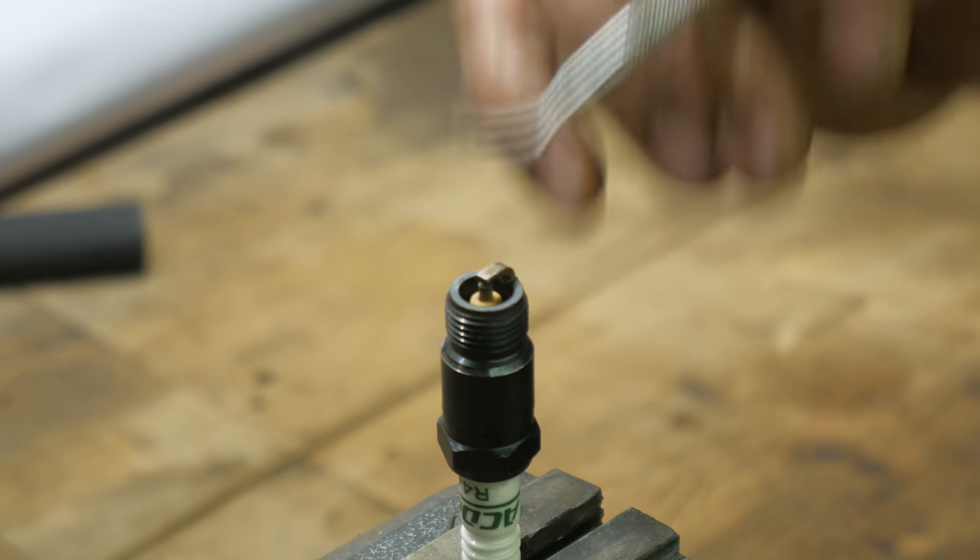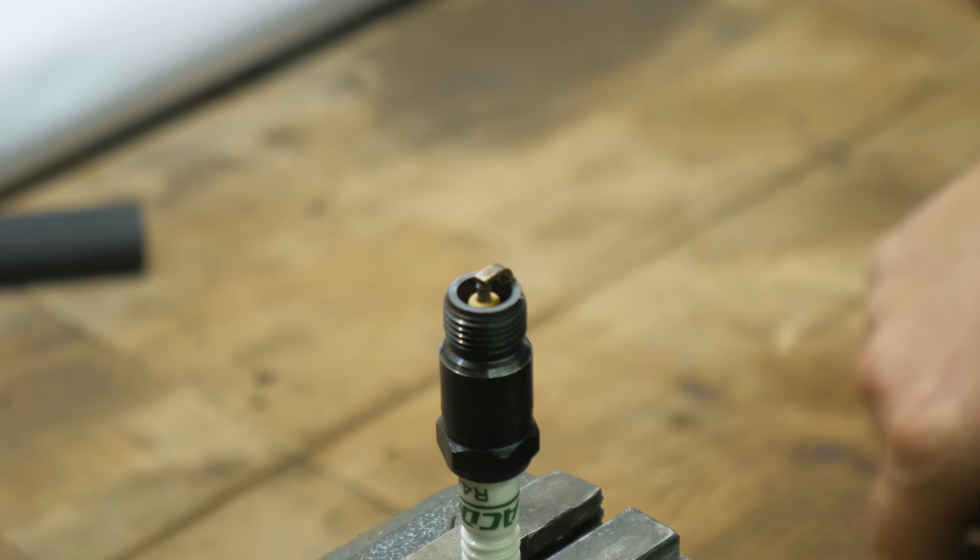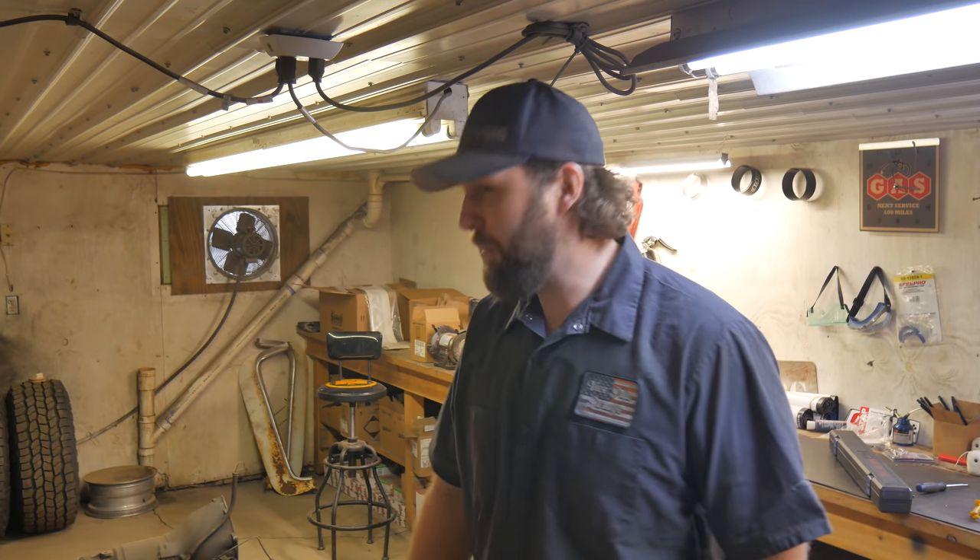Overall my heat range is good. I've got to get my timing back down to 34-35 and I need to go fatter on my fuel mixture. So now when I plug in my EFI, I know exactly where I need to be as far as target AFR. The reason it leaned up on us towards the end was we put that one-inch spacer in there, so we changed the air velocity and fuel mixture quite a bit. When I put that Holley EFI on, we can set the target AFR, target timing, and target idle. You just input it into that box and it automatically does the thing - so we can skip all the testing and tuning.